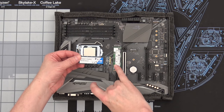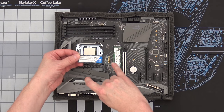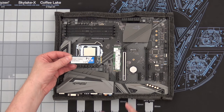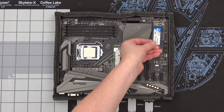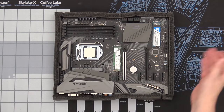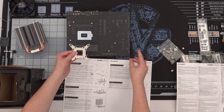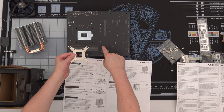Taking our second SSD — this has two notches instead of one because this is a SATA drive; the port supports both. It goes in label side up, just like so, and then screws into place. Two SSDs successfully installed.